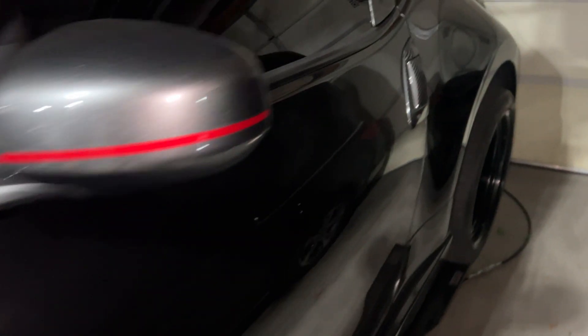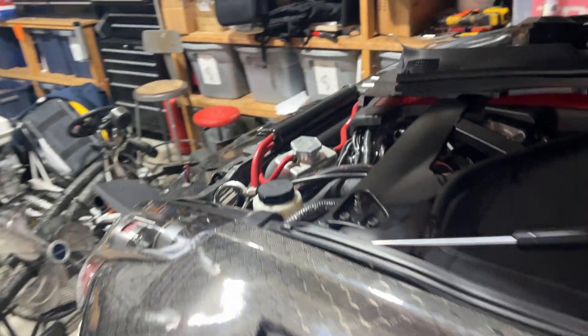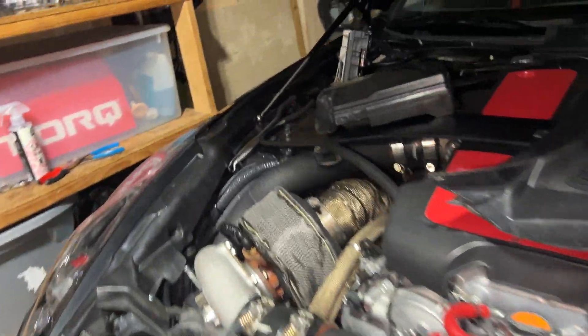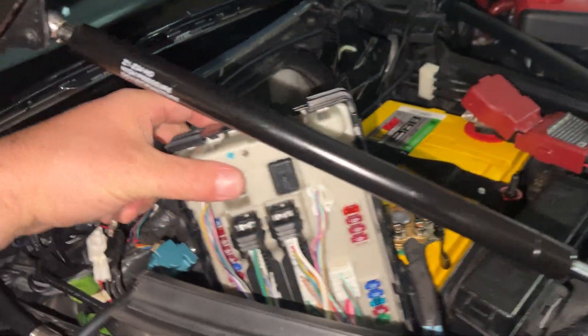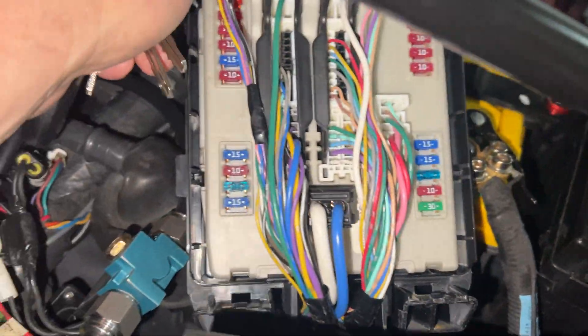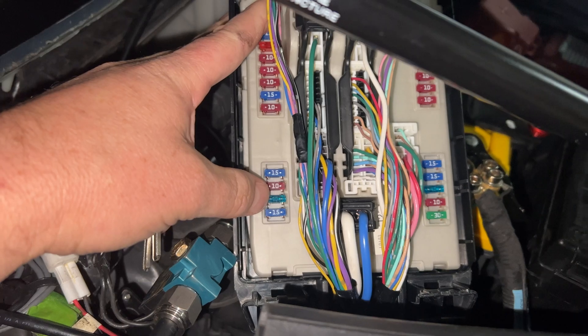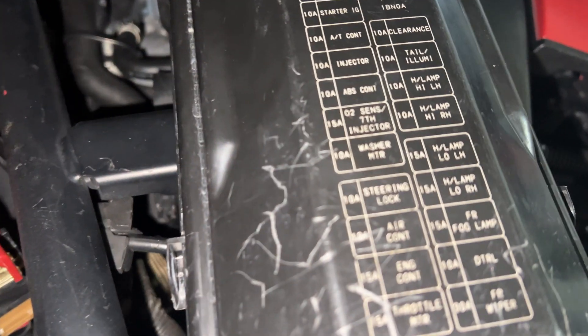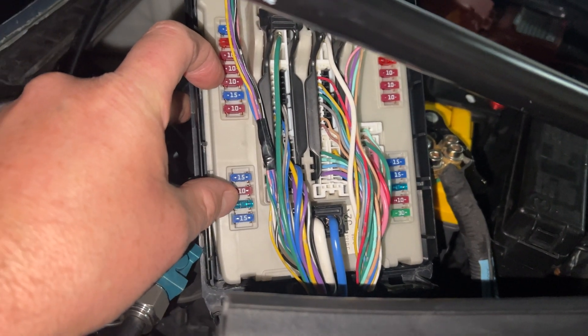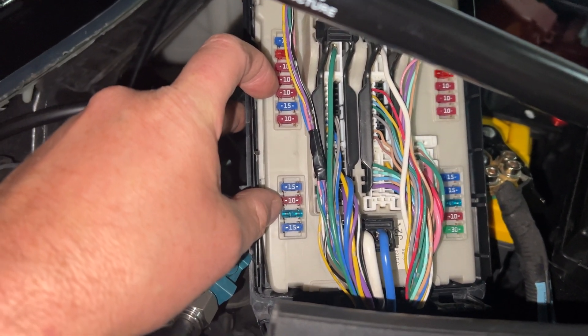Before, I checked all the different fuses in the cabin, but two times now it's always been this IPDM. You have to pull this guy out, and it's this fuse right here — the second one from the bottom on the left. It's called the engine control fuse. Sure enough, it is blown. If I just swap that out, it'll fire up, and we'll do that now.